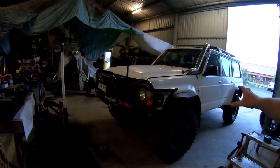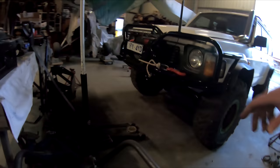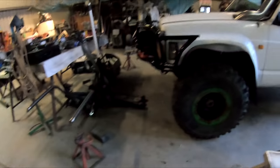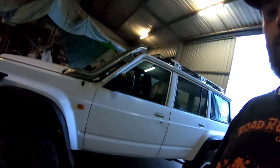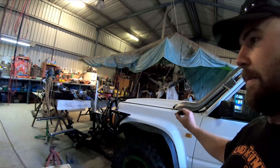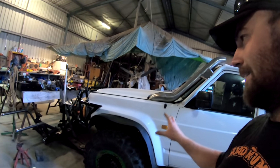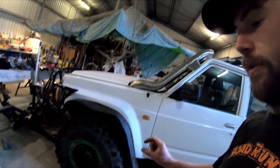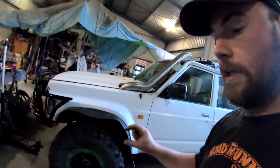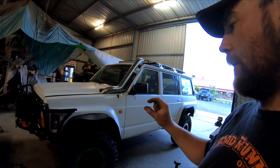It's finally sitting back under its own steam. There's 35s on the other side but 37s on this side, which is the side I want to check. It actually looks nice with the 37s on it. I checked the shaft exposed on the shock and it's about five and three quarter inches - that is perfect. That's exactly where I wanted it because I always leave a little bit of shaft exposed when it's at full bump, just in case for a hard hit.